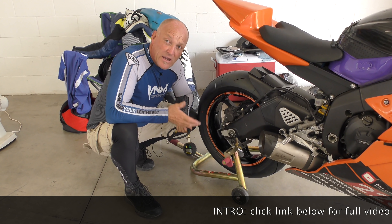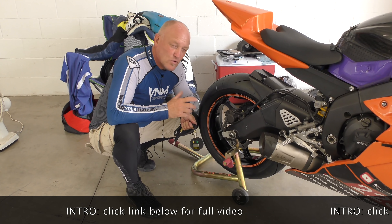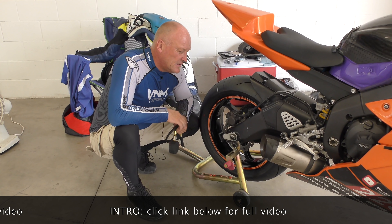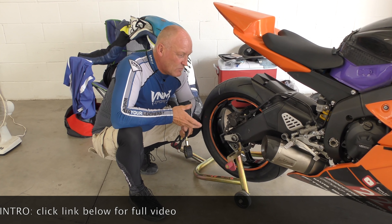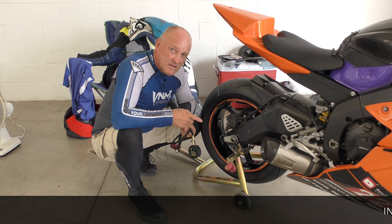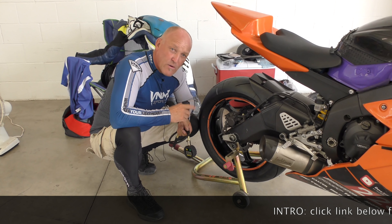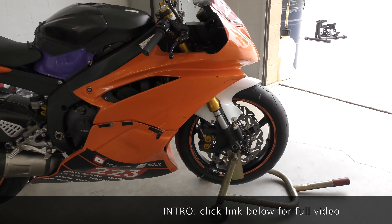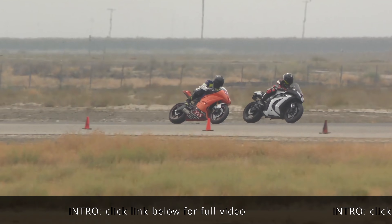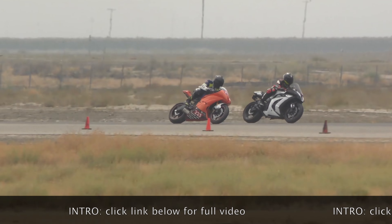These are very, very soft carcass tires. On my initial ride out and scrub-in I'm going to evaluate: are they mushy? Is the pressure too soft — can I feel the bike wallow on the sidewall of the tire under acceleration? Scrubbing is evaluation, so it's all about feeling. I'm going to evaluate how the brakes work, does the tire flatten out in profile, do I need more air on the gas, does the contact patch get too big too quickly and my line goes wide? No tire warmers required — we'll go out just as you would normally and scrub in.